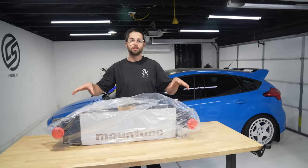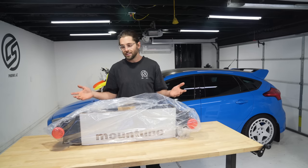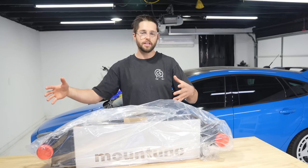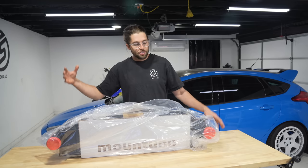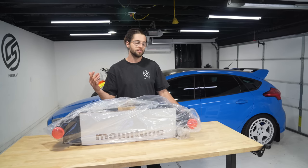What can be alarming about a front mount intercooler is how much added weight there can be at times, but that added weight gets you so much extra power across the whole spectrum. On a hotter day you need all the intercooler you can get — colder nights it's not as necessary, but it flows better across the board. You're getting more power, so you're going to move the car quicker across the ground even though you're adding weight, which is rare.